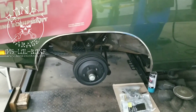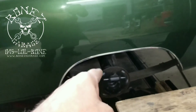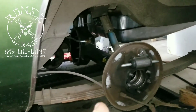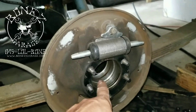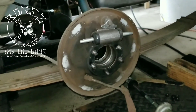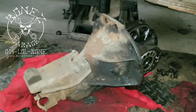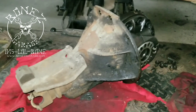The drums were still within specs, so we were able to cut them. On the back end of the car, we took the whole rear end out and cleaned everything out of the rear differential housing because there was a lot of dirt in there. We are also going to replace the inner seal, the outer seal, the axle seals, and the bearings. Once we get everything put back in, we'll put all the brakes back together and put the center section back in — that's known as the center section, the pumpkin, or the third member, depending on who you are.